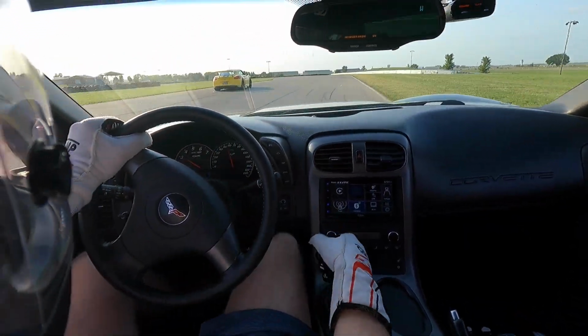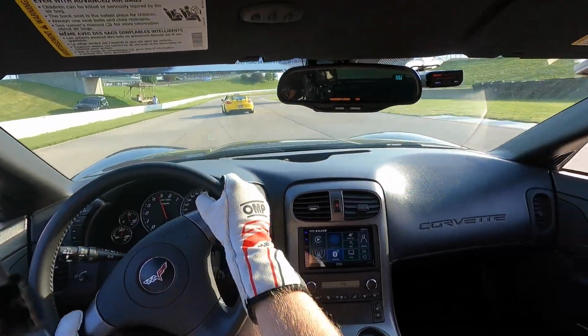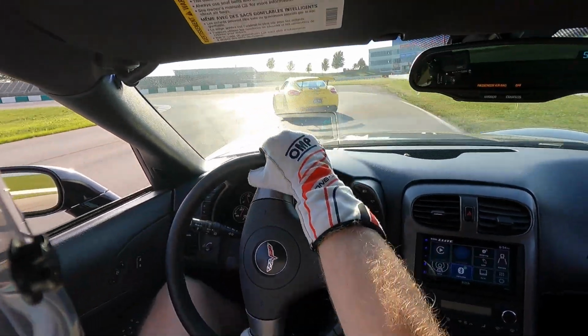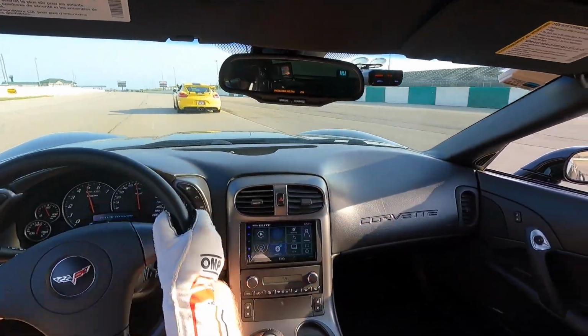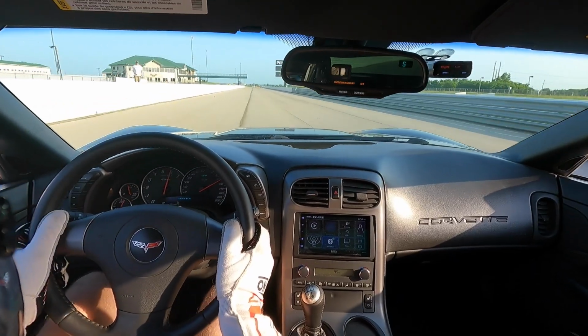I really like driving hard on track. And I think as a whole, it is much more difficult to make a supercharged car handle track work in high temperatures consistently. Thermal management definitely becomes an issue, although with the turbo motor, you're still dealing with some of that. But I think in general, forced induction requires more to manage when you're pushing it really hard for long durations.